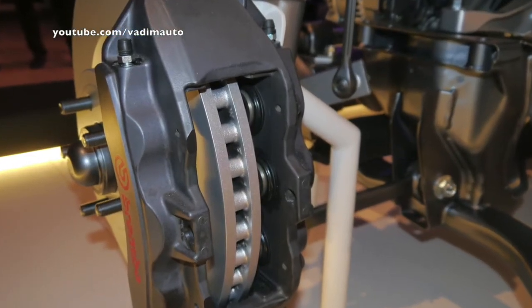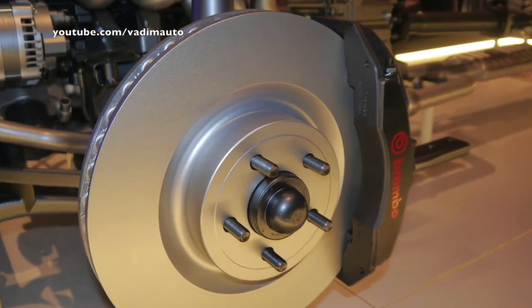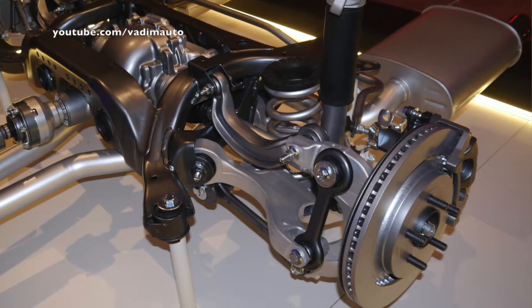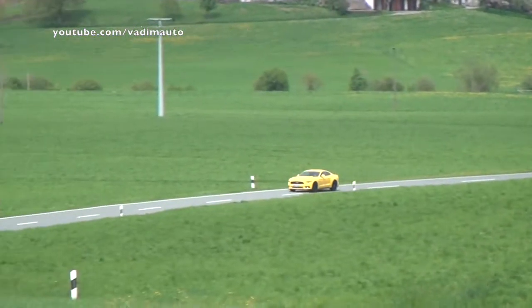On the performance pack, we have a fixed six-piston aluminum front Brembo, and on the rear it's a single-piston cast iron. Combined, the rotors are also very big, so we're getting very good utilization of the brakes. On the EcoBoost version, the front brake is a four-piston fixed caliper aluminum — it doesn't really need the six pistons that the V8 has. We always try to match the components to what performance is needed.